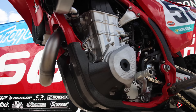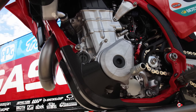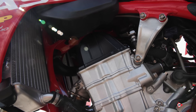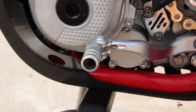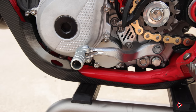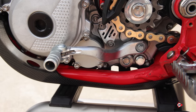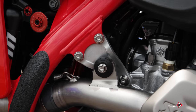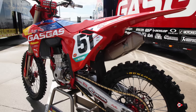Yeah, so we have factory services in-house at KTM that does all of our engines and internals. Can't touch base on that. We have a Kite clutch sleeve. We actually just got a new billet shifter for him with a bigger tip that's round, not squared off, which he prefers. The billet shifter should be OEM length, just a little beefier, and obviously looks nicer. Fairly level with the foot pegs. Engine hangers are just stock. We've tried softer and stiffer ones, and he prefers the OEM.